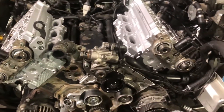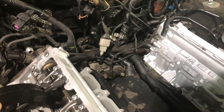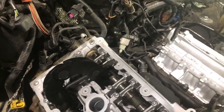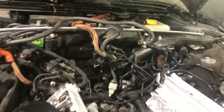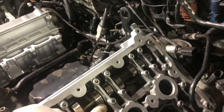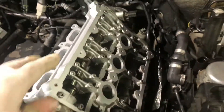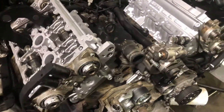We've got the heads all torqued completely. Now we've got to put the cam locks in — this is going to be fun. We know that cylinder number three and cylinder number five are at top dead center and we know where the lobes are, so those valves won't open. The other valves, if they open, won't touch the piston. It's just three and five that would possibly touch a piston, but we know we're not going to do that.